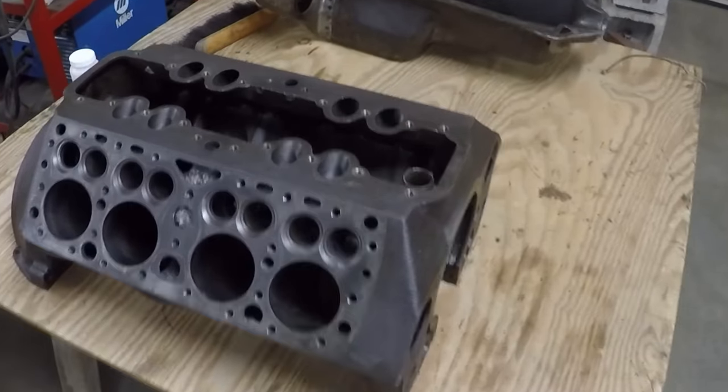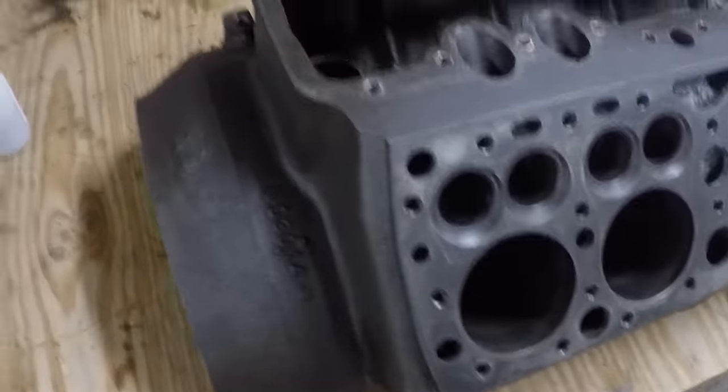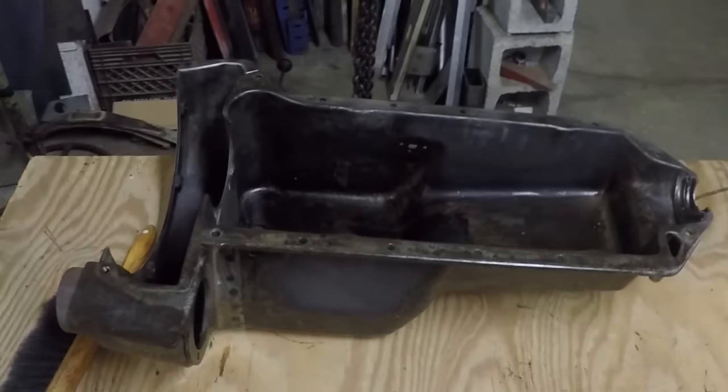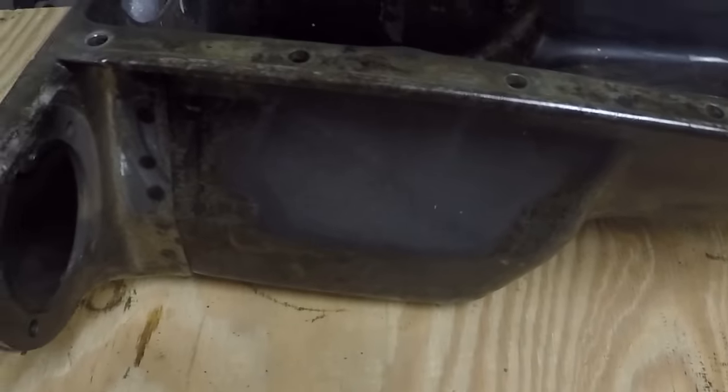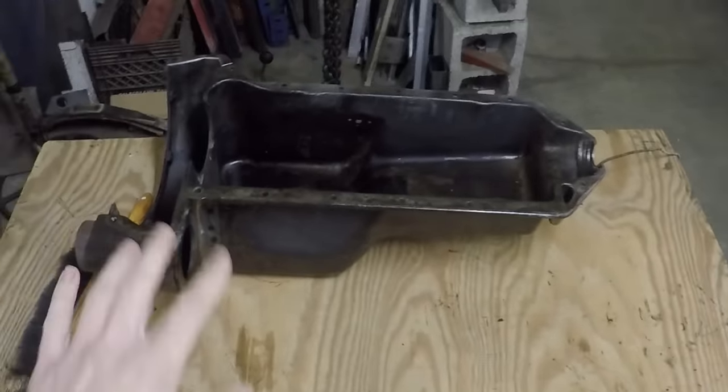Overall this engine cleaned up really well. This is my first time ever using electrolysis and I think it turned out really well. When I first pressure washed the oil pan over the summer, there was a lot of very hard, dirty grease on the outside that was so hard even the pressure washer wouldn't take it off. But when I pulled it out of the electrolysis bath, all that stuff was gone — I didn't even have to do anything to it. That really shows how effective electrolysis is on grease and rust. If you have any rusty parts, even a whole engine, I highly recommend electrolysis. It's very simple, easy, and cheap if you have a battery charger like the one I used. Thanks for watching and I'll see you next time.